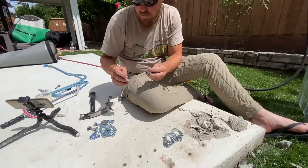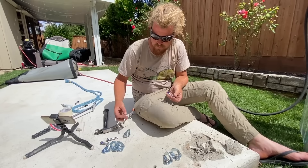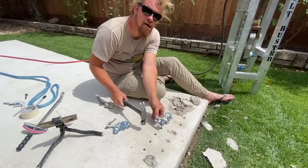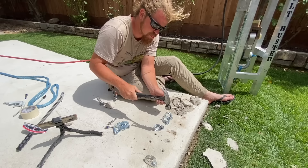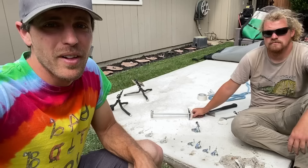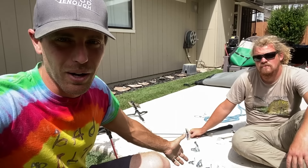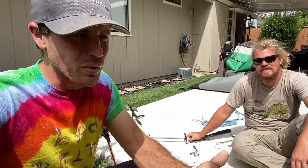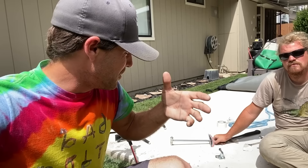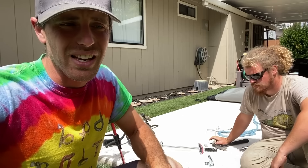This one, let's do 50% — about one and a half turns, or just shy under 10 ft-lbs between the 5 and 10 mark. And then the next hole we're going to do 200%. This is a time-lapse of these two bolts getting installed. He put on about three and a quarter turns — barely over three, just like our first one — but it got about twice as much torque, around 25 ft-lbs. So just turning something three or four times doesn't mean anything; it's all in how it engages in the rock. The size of your wrench is more consistent than how many turns you're turning your bolt.